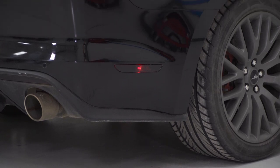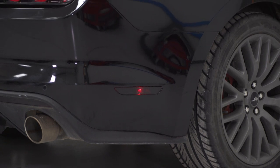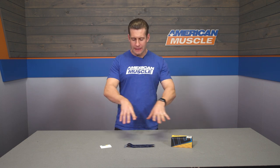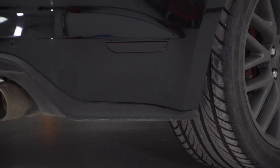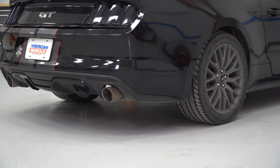As for the vinyl itself, you'll find what is called an optically clear 5-mil vinyl which, despite its very dark smoked appearance, will still allow up to 80% of the light to shine through — which is very solid. That vinyl is a 5-mil thick material designed specifically for covering lights on automobiles and consists of three individual layers: the outermost protective layer, the tint layer in the middle which gives you that smoked appearance, and the backing layer which allows the vinyl to adhere to your markers. The protective layer will also add some protection to the marker lenses against impacts from gravel or debris.